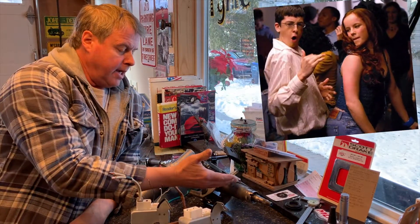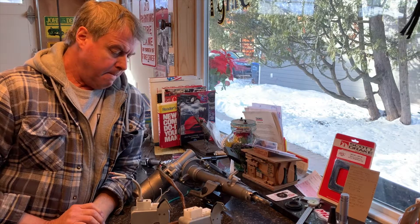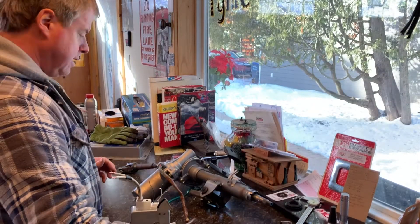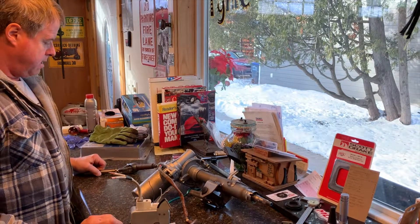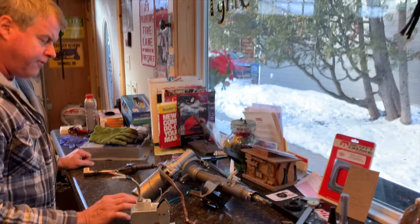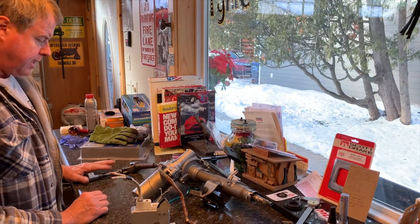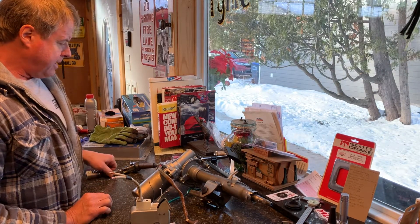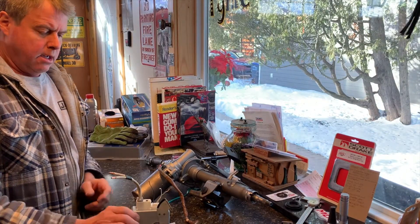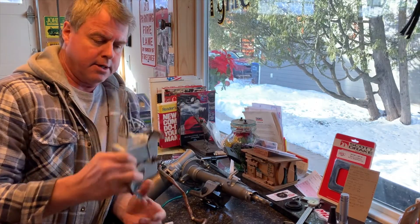I started this project by grinding off the superfluous components that I don't need, leaving this fat sleeve on there. If you buy one of these they usually come just like you see. This one happened to come with an extra tail piece that I believe the gentleman Wade needed for installing on his old Ford, because he also installed a rack and pinion that is almost straight down from the firewall - so you'd need that extra u-joint and tail piece if you have rack and pinion. I don't, so I cut this u-joint off and this is the only u-joint that I need. When you buy one of these make sure it has the wires - you can buy them with no connectors, and you can't wire it to the car without the connector.